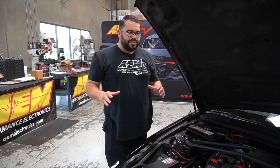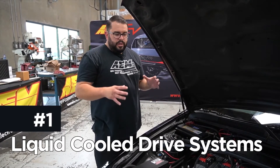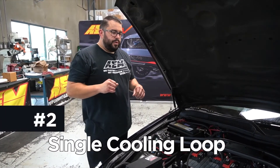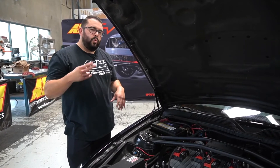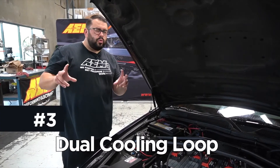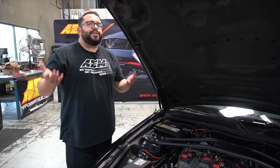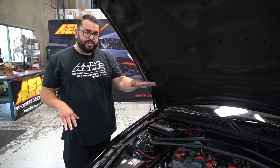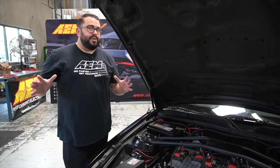As far as thermal management goes, the VCU can support three different types of thermal configurations. One is if your drive system is liquid cooled only — on this particular car the energy storage system is all air cooled with no active cooling. Configuration two is putting the drive unit and energy storage system components on the same cooling loop: one radiator, one coolant pump, one radiator fan. The last configuration is a dual independent cooling loop for both the drive system and the ESS, since the drive unit typically gets a lot hotter than the batteries and you want to cool them separately.